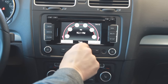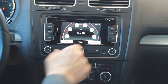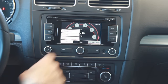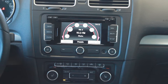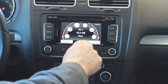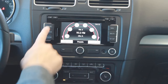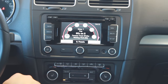Press and hold for three seconds and it'll save it as a preset on that individual circle. If I go back to band and switch to FM, again I go to options, tune, to tune between stations — I'm going to look for 93.3. Once 93.3 is selected I hit options, presets, then press and hold whichever circle I want it saved to. You can save up to six on the main screen, and if you twist the dial there are also seven through twelve available. You can do the same thing with AM and Sirius Satellite Radio.